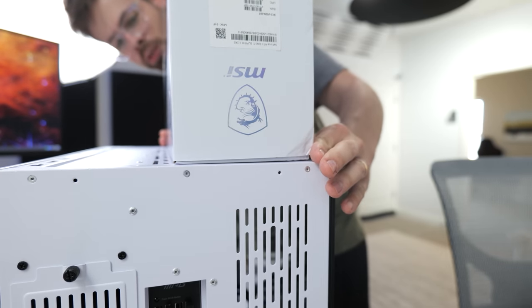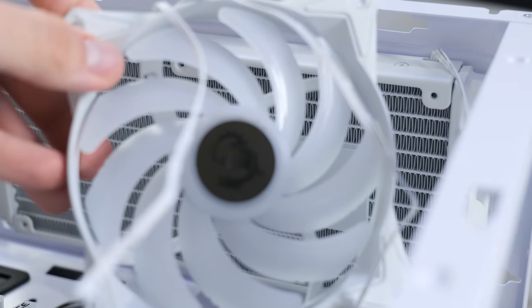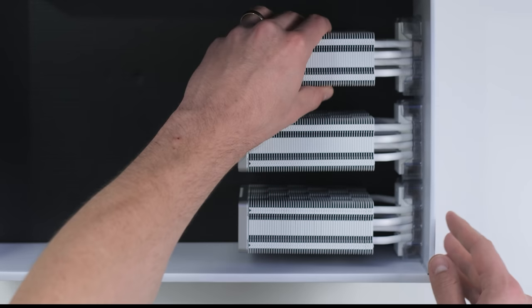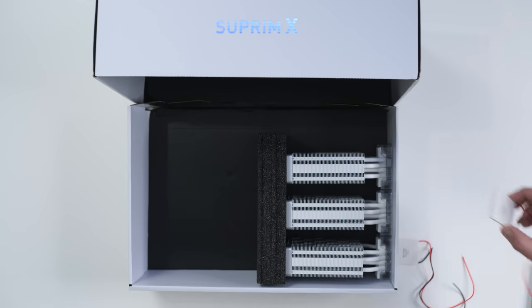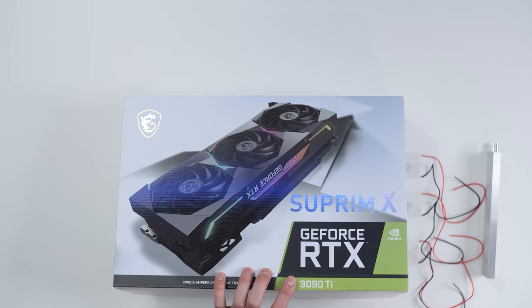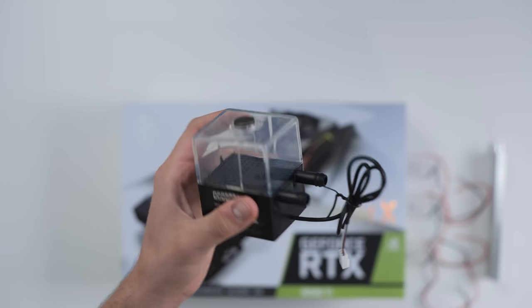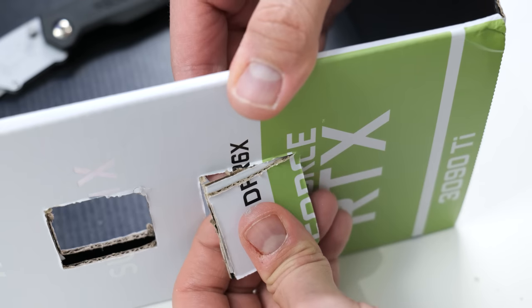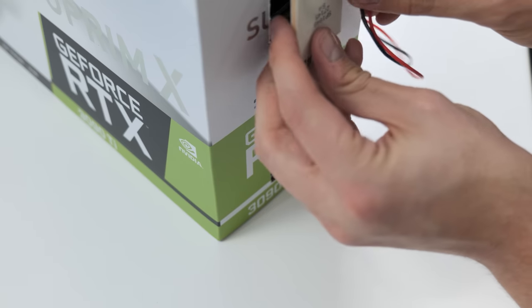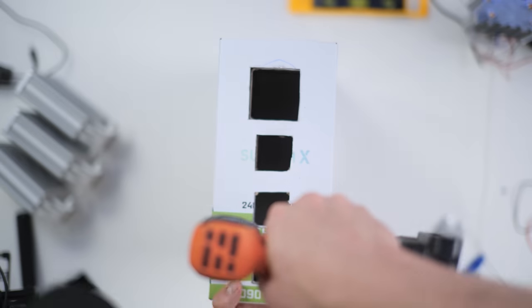I needed something that perfectly fits on this section — no way, it fits like a glove! It's cardboard but this is a prototype. I'm thinking I use one fan to pump all the heat from the PC straight onto these heat sinks, which absorb heat from the GPU and CPU and transfer it all onto one side of the TEG. Inside this box, the cardboard acts as an insulator so heat can't escape to the cold side. The thickness is perfect — slot right in there!